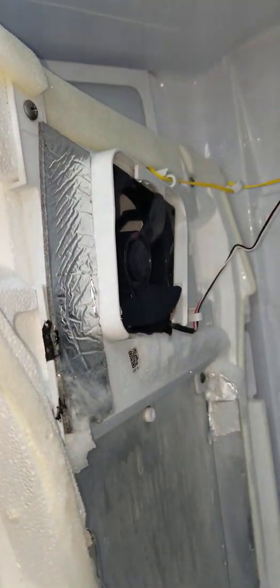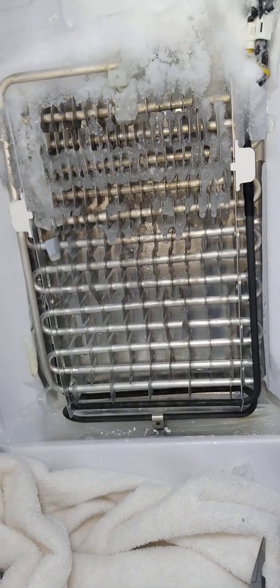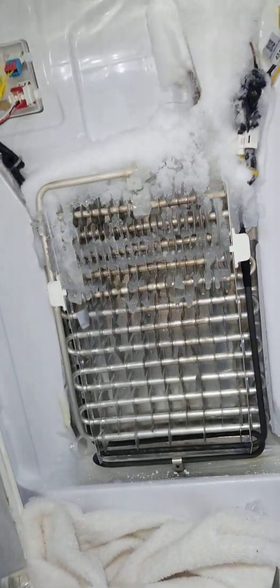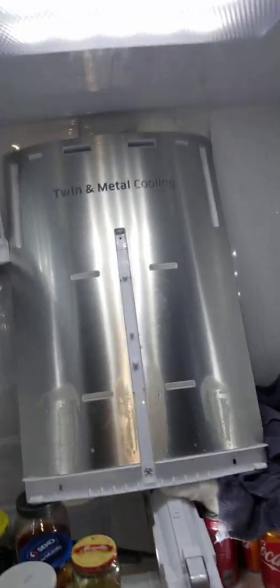They had an issue where the fan was inoperable. What happened is after this thing goes back into cooling mode and the frost condensate couldn't drain, the fan recirculates it — those droplets recirculate and accumulate right behind the fan where the airflow is. They build up there until they get against the back of the fan when this thing is put back in place. And when it's fully in place, the fan can't turn.